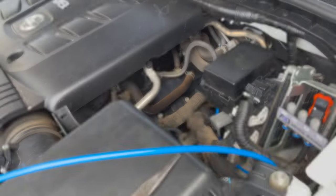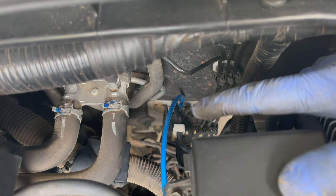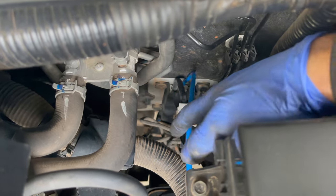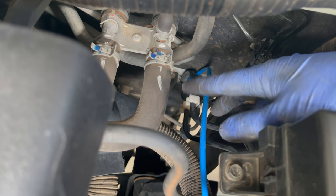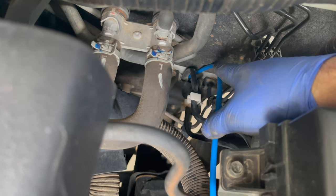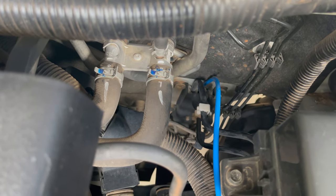Down here there's an attachment on the wall that some of the hard lines, factory lines, run through. There's actually a spare section — I'm not sure all Patrols are going to be like that, TIs might be different. There are some plastic clips and a factory heat shield that these pipes run through from factory. This middle section was spare, not used, and the plastic clips and everything are there. I was able to feed the rear diff breather line, this hose, straight down through the middle section that wasn't being used. So that's a good option — it's heat shielded, it's out of the way, it's away from the exhaust, and it can't rub through.